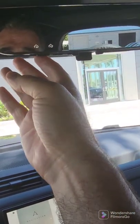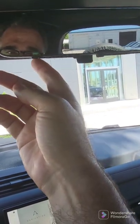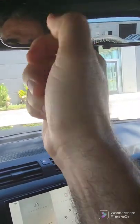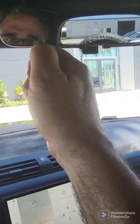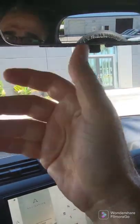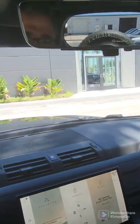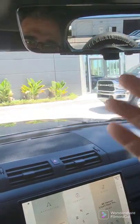When you have an automatic garage opener, you'll press this. Then take your garage opener and press it until this starts blinking quickly. More often than not, this will work once it's done that — then take the clicker away. When this stops here, go ahead and press it a couple of times to make sure that this is actually configured for the garage.